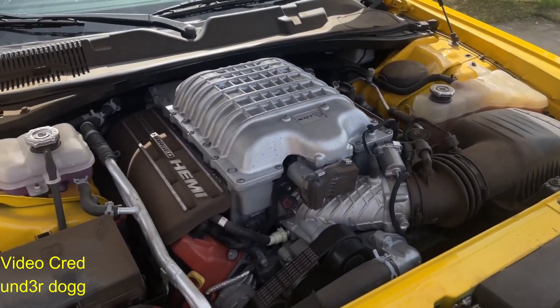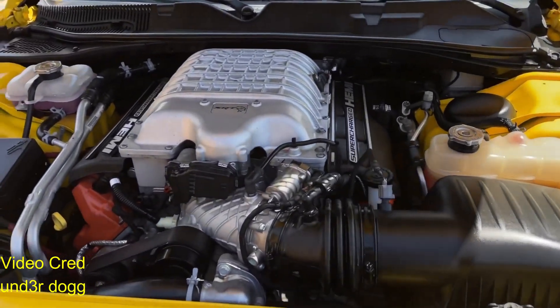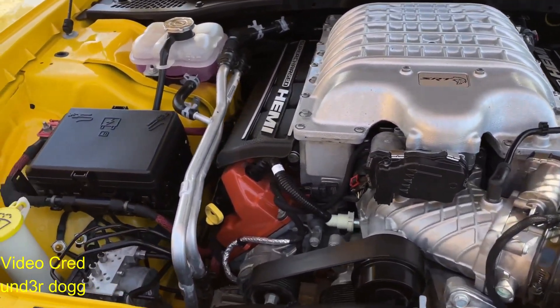It's a bit more complicated and more expensive, but it's still a top-mount blower like the roots supercharger. This type of supercharger is really good at the lower ends of the RPMs but it kind of drops off once you reach the top end. The parasitic draw on these is significant, but not too bad. Boost is also delivered quickly on these, and they're more efficient than the roots superchargers and run a little bit cooler.